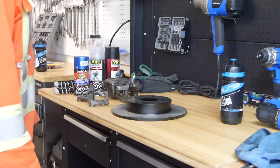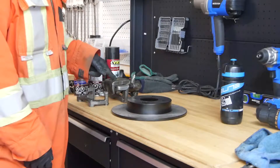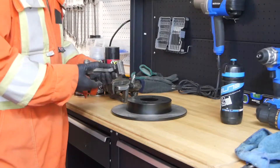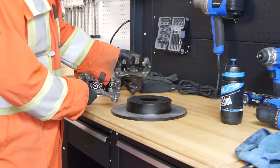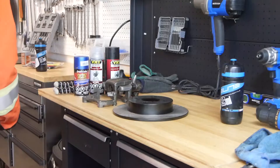The first thing I'm going to be working on today is the rear brakes. I got some new calipers for the car — they're for an Infiniti G20. It's the same OEM style caliper but I'm going to use a larger caliper mounting bracket. It spaces the brake out a little bit more and lets you run a larger rotor — same thickness but a larger diameter.